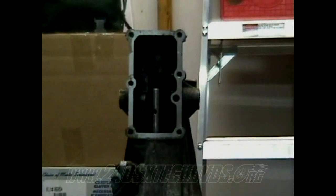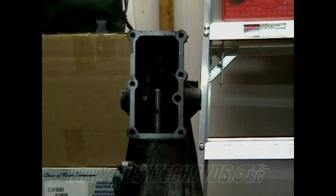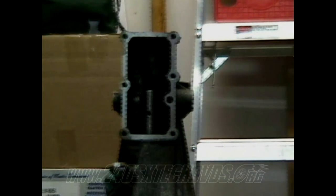And my S14 transmission doesn't have the striker arm in it, because I bought mine off a guy that did an RB swap, and that's another good thing to look out for. People that do RB swaps usually take the KA striker arms, because they want to go to a short shifter, like a B&M shifter. They need that striker arm for it, which only costs about $30 if you buy them brand new somewhere, so it's not really that big a deal. But I just thought that would be a good note to add. That's what they look like right there.